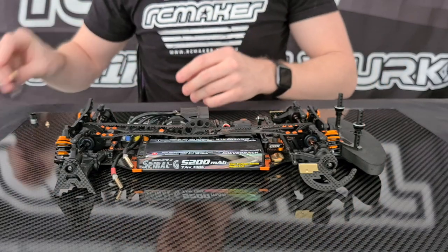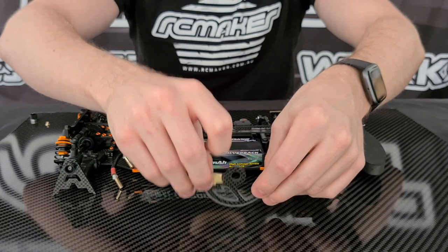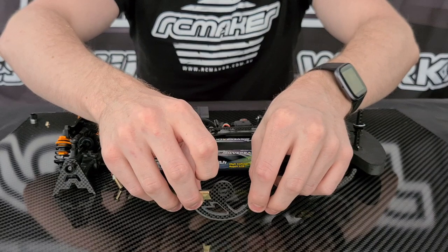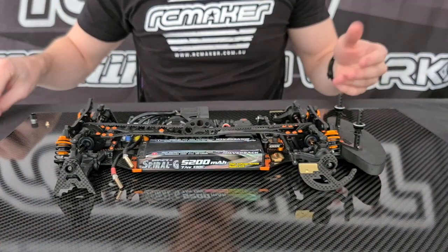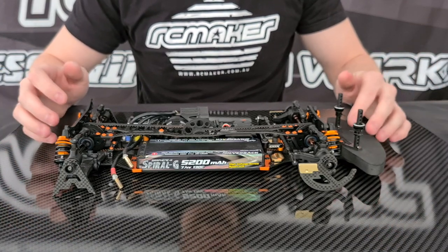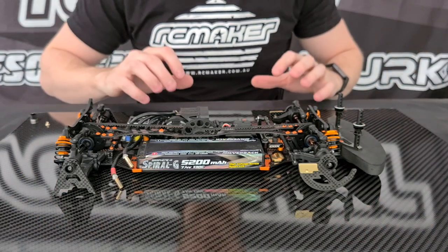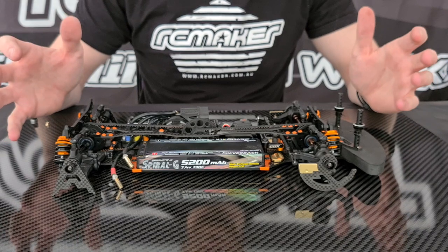What this does is that offsetting the weight means that when you lift this off and release any friction from the wheel, the wheel's going to spin because it's on a bearing attached to the axle. So as soon as this wheel lifts off the ground the wheel's going to spin. Basically the way we can use that is to help detweak the car. Normally it's very difficult when detweaking to see which wheel's coming up first — you often have to get down low to see which wheel's coming off the ground first.